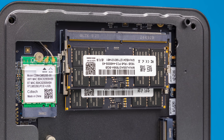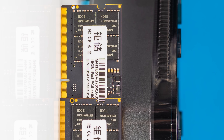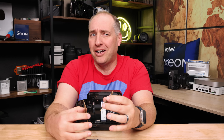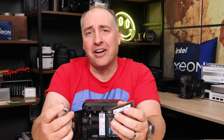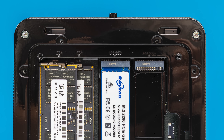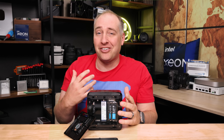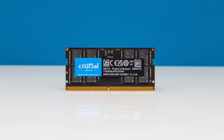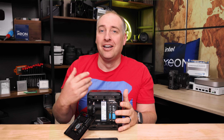The RAM was another concern. The two 16GB sticks that came in the system have chips marked 'HOGE' — H-O-G-E — a manufacturer that makes RAM and SSDs using all kinds of random components, but you don't really see many RAM packages with their branding. Overall this is a pretty good package, but I get nervous when I see no-name components, especially when competitors like MinisForum and Beelink use fairly well-known brands. Personally, I would order the bare bones and add my own memory and SSD — I just wouldn't spend an extra $140–$150 for no-name brand components.